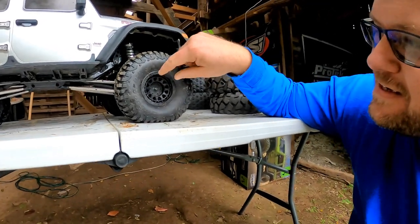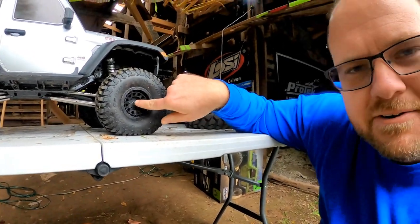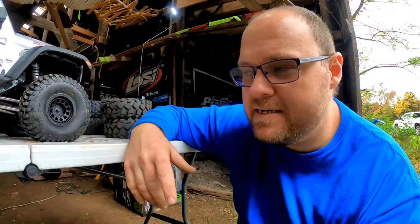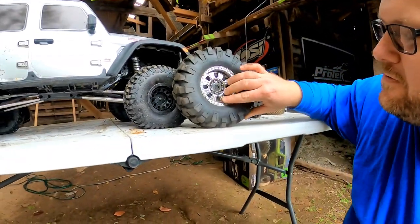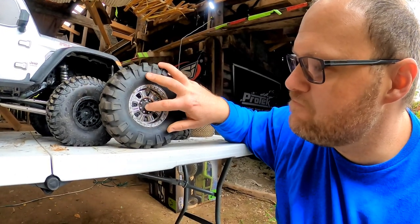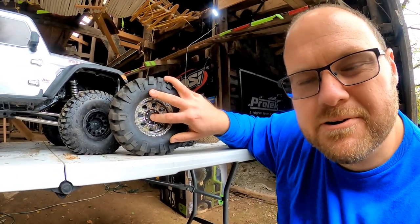It's a lot. And then you get the cap off, and underneath there is actually a 10 millimeter nut, which is useless as near as I can tell, because most of the time when you have a 17 millimeter hex on any other wheel that's out there in the world, it also has a 17 millimeter nut on the outside. But we are still going to put these wheels on this truck and see what they look like and see if we think they will clear, so that at least you know if you have some choices out there and if they can actually even get close to working.